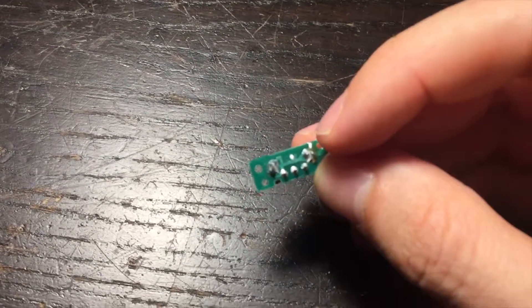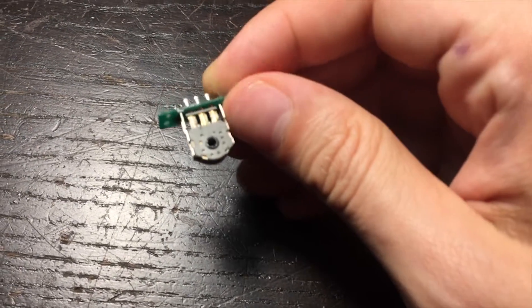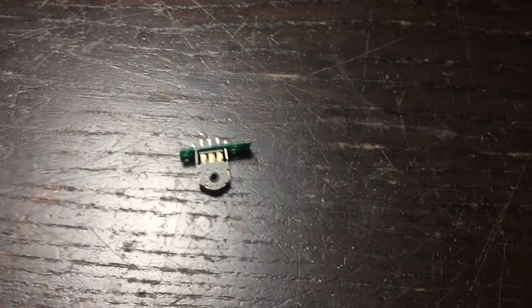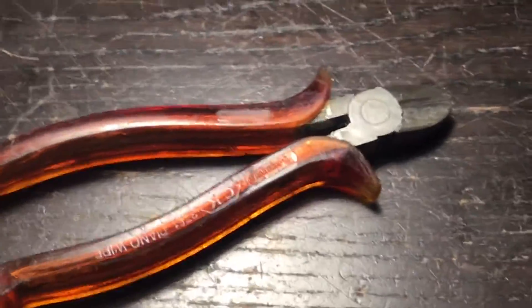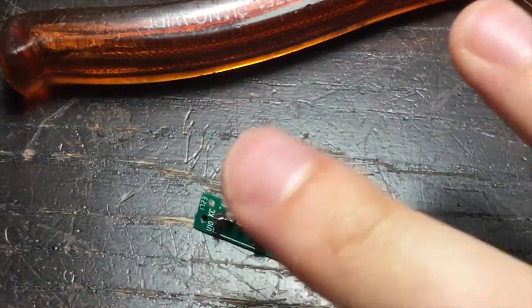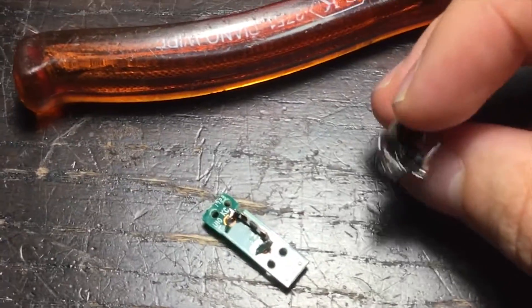You can either put flux here and remove it with desoldering wick, but you should first cut these two large connectors on the side. Be careful not to damage the PCB because there are some tracks there. I had to switch over to my iPad for the camera. So these are the big pliers I used to cut off the encoder. There's the encoder I broke off — I just cut it on the side. Be careful not to put too much mechanical stress on the PCB. If you break the PCB, your mouse is done. So that's done and you can throw the old encoder away.